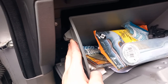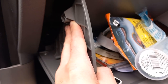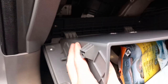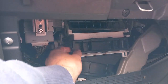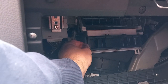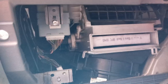It was super easy. As the diagram showed, you press inwards on that plastic glove box and effectively these bits come loose, then you can pull it open. All of my bits will probably fall out, but the main thing is there's our plastic bit which needs to come off. Looking at the diagram, these bits need to be pulled out — there we go, nice and easy. Let me just pull the other one out, and there's our cabin filter.